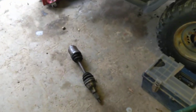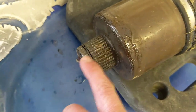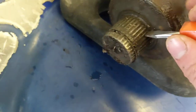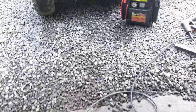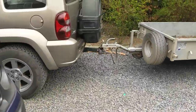I'm driving about seven or eight miles without it falling out. The reason I'm taking it out now is because I had hoped the splines would be good enough for these original axles to work. As you can see there are splines left in there but they're not particularly deep. If I get a screwdriver in to measure the depth — you can see that barely touches anything, there's hardly any depth to those splines. I'll run over to the truck where I've got the new axle — unfortunately the wrong size — to show you what new splines look like.